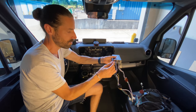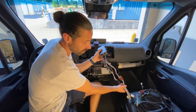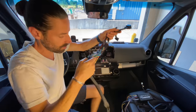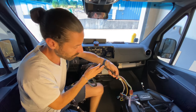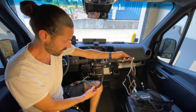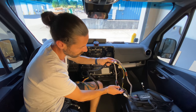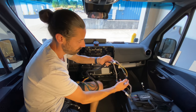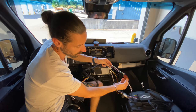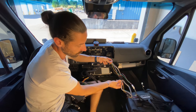In this scenario with just a subwoofer, some wires on the amp are unused. The next segment is a harness that comes in the subwoofer packaging, which plugs into both the amplifier and the subwoofer. This harness is about two feet long with connectors attached. On one end, connect the black and yellow to the amp, and connect the green, white, gray, and purple with the brown harness to the brown harness on the amp. The black and gray end goes into the black harness on the amp.